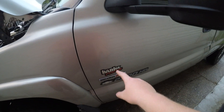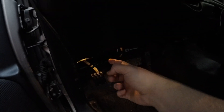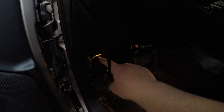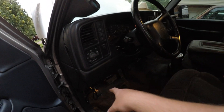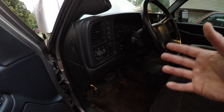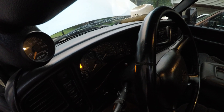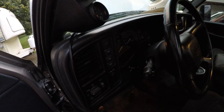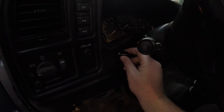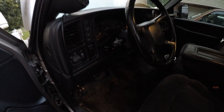Inside the cab, it also came with these really nice badges — I've got one on both doors and one on the tailgate. Inside the cab you have the diagnostic port, and this wire runs out to the module. It's important that you have this connected. I learned through the diagnostic codes that if you don't have this connected, it just flat out won't work. A nice feature of the EconoMind is that there are indicator lights on it — if they're flashing red, the pattern will tell you what the issue is. This other wire interfaces with gauges like the iDash from Banks or anything else. And then of course you have the six-position switch right here. It's awesome on-the-fly tuning — add or remove power as you need it, and it's seamless. You don't even know what's happening. It just works.